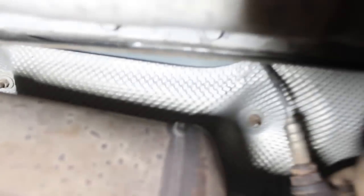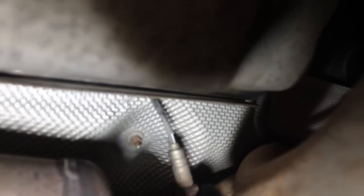You can see here's the front sensor on the passenger side and then the rear sensor on the passenger side. Again, I have a P0161 and a P0141 on this vehicle, which indicates failure of the rear O2 sensor on both sides. So the very first thing we're going to do is just grab a can of liquid wrench and irrigate that real good. Make sure you have some good eye protection on, and let that soak in for a while while you run down these wires.